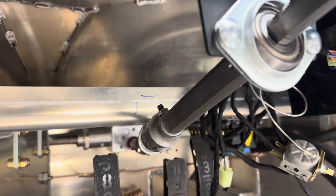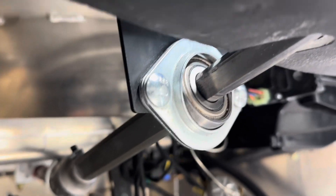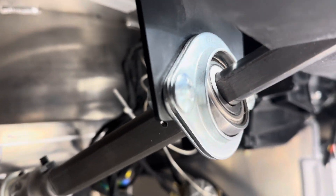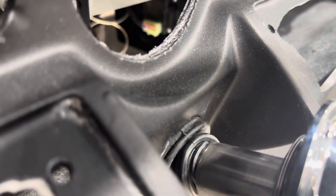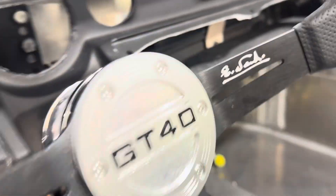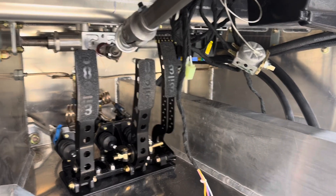You can see underneath I used all of the joints as they were basically intended. You could cut that bracket off and increase that angle just a hair, which would bring that column up a little bit more in the flat part of the dash — probably a half inch or more. But you're not really accomplishing anything because it's already past your feet at that point.